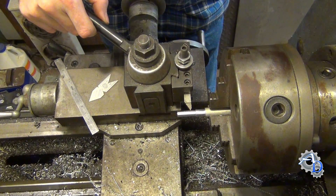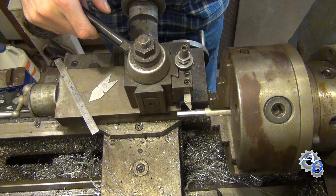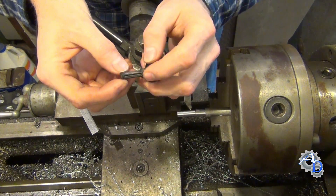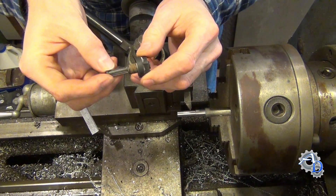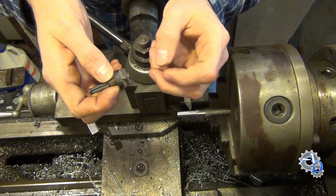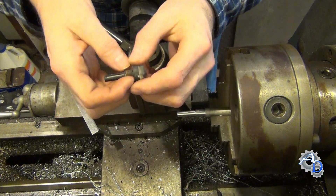Today's dilemma was it was starving for fuel. The metal fuel tank has a lot of rust in it, and I'm assuming that the rust plugged up this ultra tiny screen that they have on this fitting — as you see there's not much room there to plug up. I was taking this apart, taking the hose off, and instead of the hose coming off, the fitting just busted off, of course.